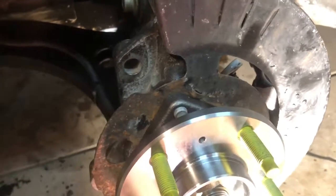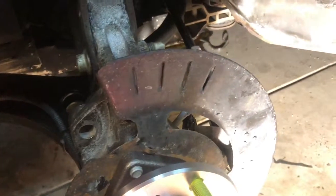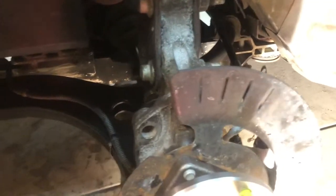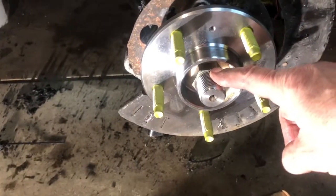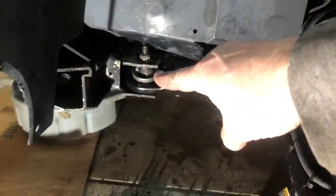We'll put the brakes back on but maybe not the tires just yet — I'm going to clean the underside really good and then do the transmission servicing. The light at the end of the tunnel is here; everything is on and torqued to spec. Just in case you're curious: the axle nut is torqued to 108 foot-pounds per the manual, and the lower control arm fasteners are 92 foot-pounds.